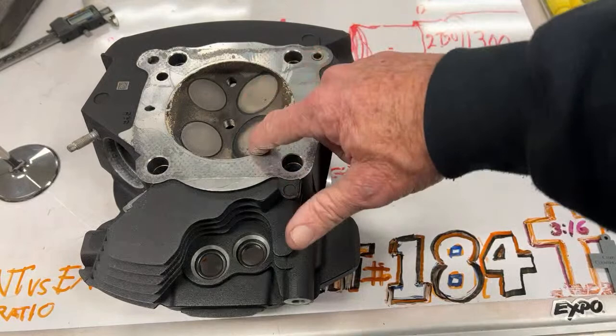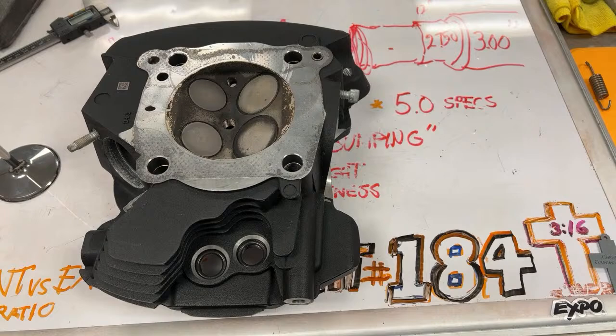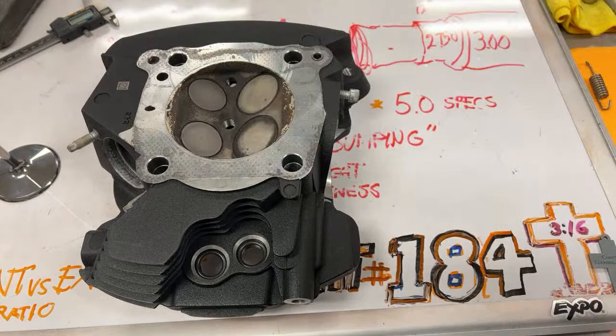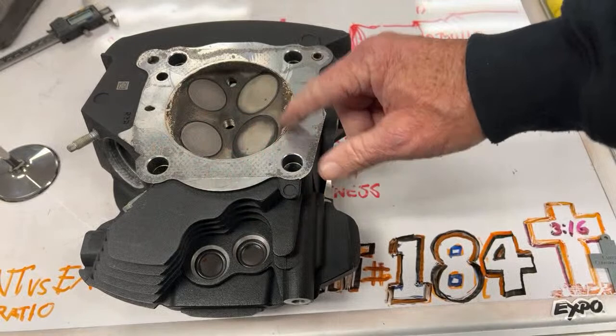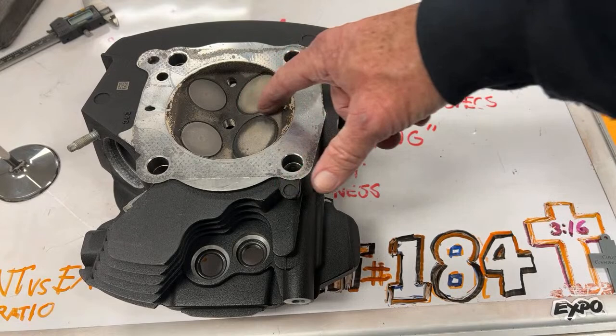So we started going with really big bore. So by opening up the bore, we were able to scribe this out, put a big bore on it, and lay this chamber wall back, so that there would be unshrouding here so we could put bigger intake valves in it and bigger exhaust valves. It's going to be a while before we get them in here big enough where they start hitting each other in the middle, but they do.